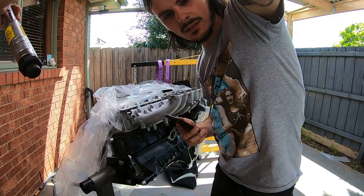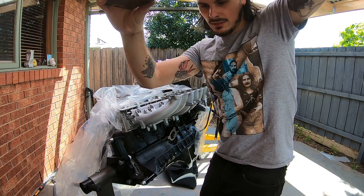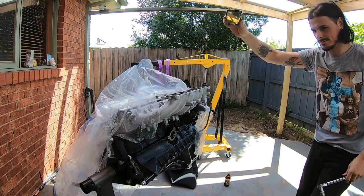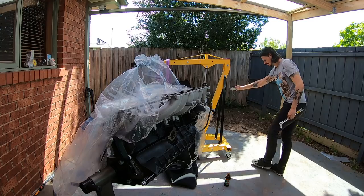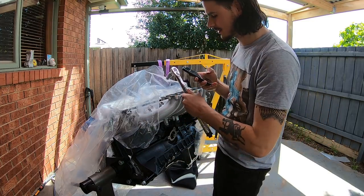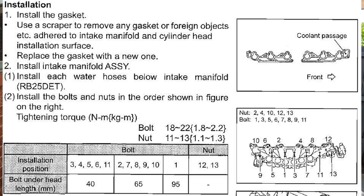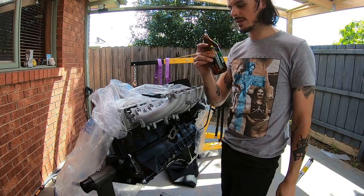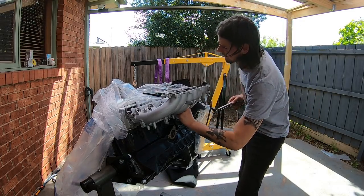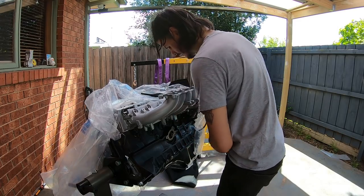A spider just dangled from my arm — that's Australia for you! Alright, put that guy somewhere safe. The newton meters for the nut is 11 to 13 newton meters and the bolts are 18 to 22 newton meters. We're going to work our way from the middle — I'll put a diagram on screen: one, two, three, four, work your way out. It's set to 21 newton meters.